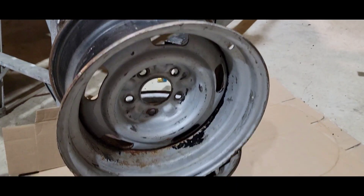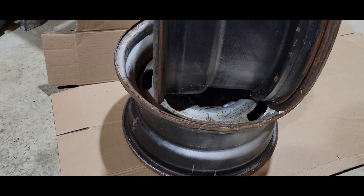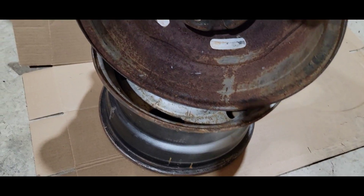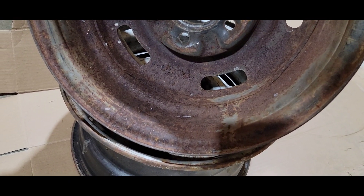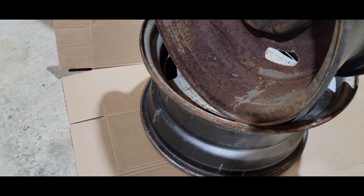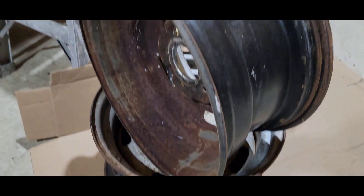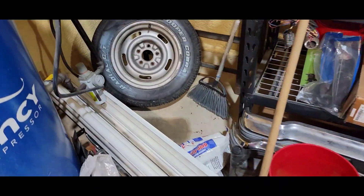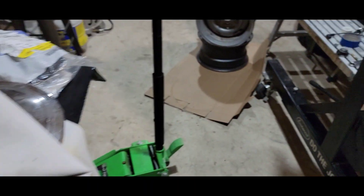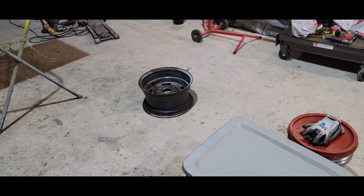These are the other two wheels I'm working on. The insides aren't too bad — this one is really decent. But it's the backs that are the reason why I put them soaking in the Evaporust, because I want that surface rust off so the wire wheel can take it off real fast and easy. There's no holes, it's not thin, it's not rotted — it's just surface rust. The other one's kind of like that too on the back side. My spare isn't in that bad a condition either, so they're going to be easy. It's going to take a little more time rather than sending them to somebody to sandblast, but it'll save me a couple bucks so I can put that money into something else.